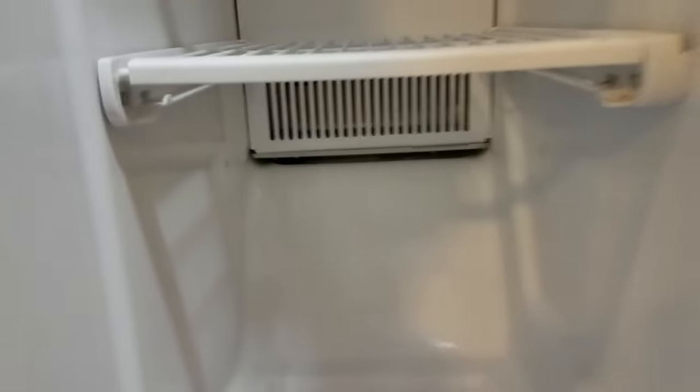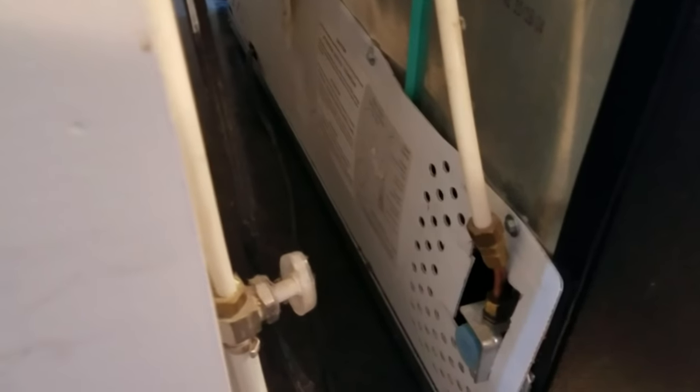If you're unlucky, you have to go to the back of your fridge, undo the panel, turn off your water and power, find the drain, and unclog it. But in most cases you don't have to go that far — in most cases you have a much simpler solution.